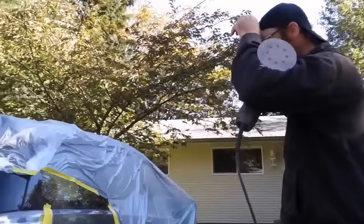Here we go again with the heat gun, drying coat number three. Now the water blends better than solvent, but you have to know how to do it. If you're blending with solvent, you blend by seeing it, so you can see as you go that it's blended out nice and looks good. But with the water, you don't know what you have till it's dry, so you can't just blend it by eye, you blend it on how you know it. But you can get away with a lot more with the water because they're better color matches. So you can do a harder blend or spot that would be harder on a difficult color and get away with it easier than you can with the solvent base color system.